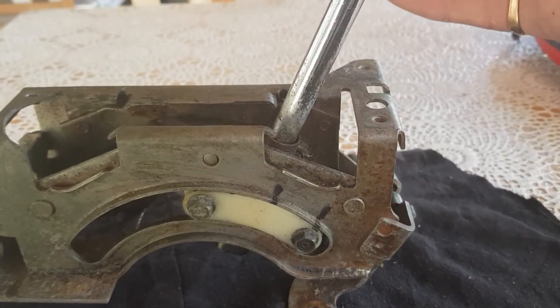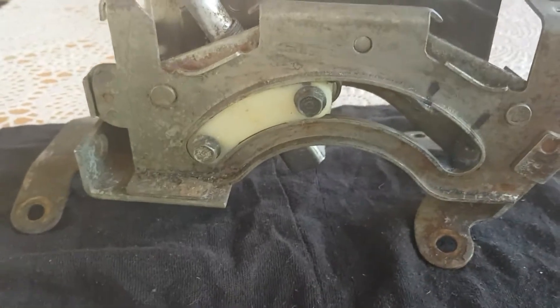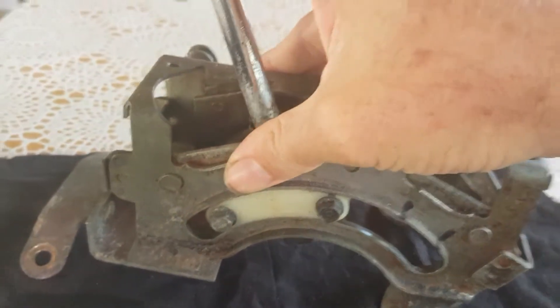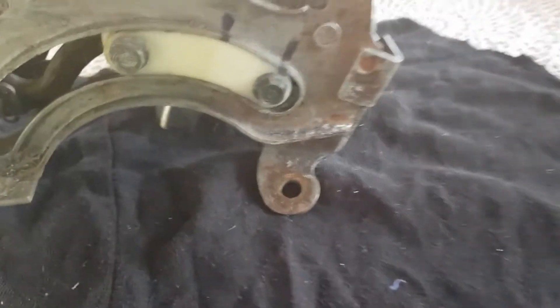Here's the shifter. For you guys who don't realize, these are actually hidden quickshifters as well — they pull to the side. If you're not aware of this, bring it down, push it to the side, click it forward, it ratchets. Do it again and it ratchets, and so on and so forth. Hidden secret — I didn't know that until a few years ago.